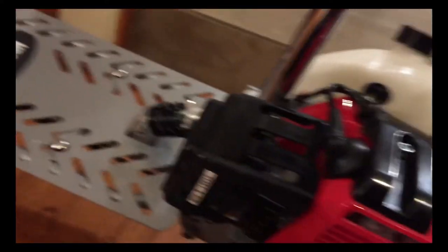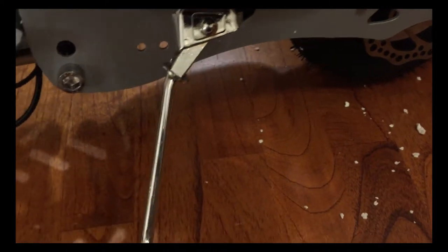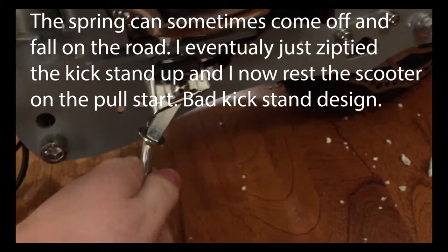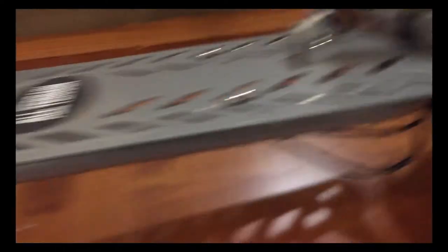The kickstand is a little weird. There's a spring behind here — when it goes past here it kinda clicks. Actually it doesn't really click — it just kind of stays. The friction is kind of high, so it'll stay. Put on the gas lines. What you really want to do is take apart your headset and re-grease it with really good grease like wheel bearing grease. Also don't use silicone spray — use wheel bearing grease in the bearings because that will last way longer. I did see some grease in the wheel bearings — there was actually an okay amount, though it was clear and kind of weird looking.